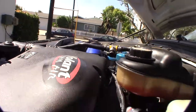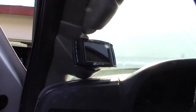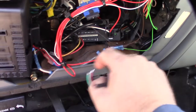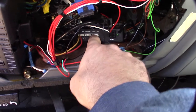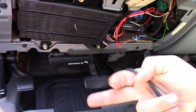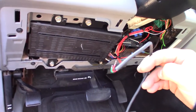There are a couple of analog inputs on the Bully Dog GT, and I want to be able to see my coolant pressure from the gauge right there. I already installed it here. That sensor over there is my EGT sensor, and for this one I'm going to solder together some wires, make a connector, and extend the length.